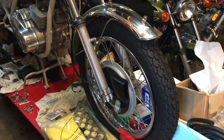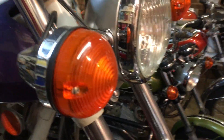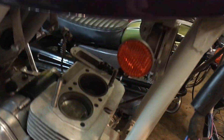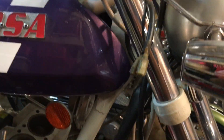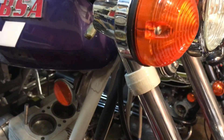Let's just do a quick walk-around. The front wheel and front end are pretty much done, and that includes a lot of the electrics because we've got an original front end harness that came with the headlight as one unit. The reason this front end has spades on it is because there is a connector block under the tank - two spade connector blocks, one on either side of the top frame tubes. That's because these models had quickly detachable front ends for when you obviously wanted of an evening to go off and do some serious scrambling.